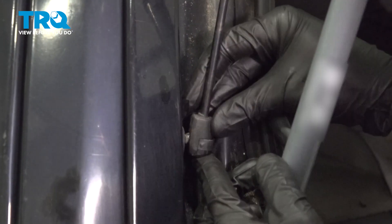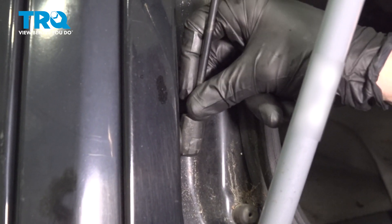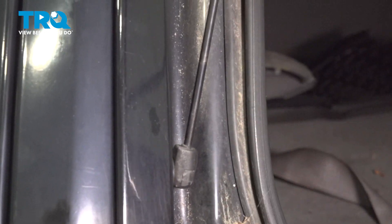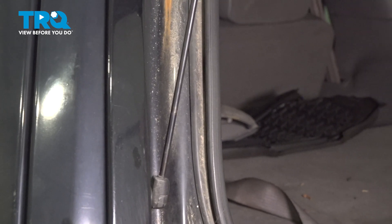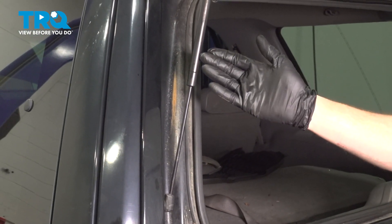Make your way down to the bottom. For the bottom, we'll just press this in — you can watch that locking clip. Once you hear it click, give that a tug to make sure it's secure. Let's remove that support rod and test its functionality. As long as it's holding the glass up, go ahead and do the exact same thing on the other side of the vehicle.